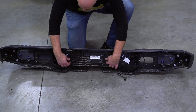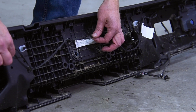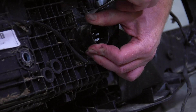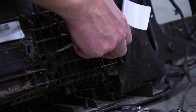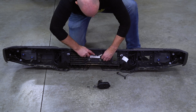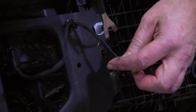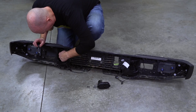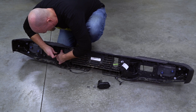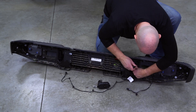On the back of the bumper you have your license plate wiring that comes across. Depending on your aftermarket bumper you may need to use this. You've also got your trailer plug here — we can just open these clips up a little bit. For our reverse wiring, just pop out all the little Christmas tree clips. Then on each side there's a little plug — work a small screwdriver right down in the slot and the plug comes right out. Same for the other side light.